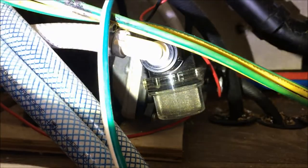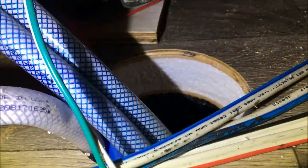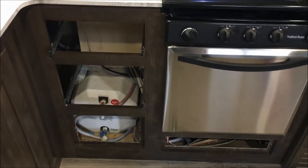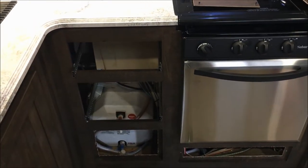The water pump is right here. That's the strainer on it, and that line coming out of the side of the strainer runs right back down into the holding tank. Now, you could put antifreeze in your holding tank and just turn your pump on and suck the antifreeze out of there, but I don't really want any antifreeze in there. It'll cause some buildup over time and you'll just have to flush it repeatedly when you de-winterize next camping season — that's something I'd rather not do.